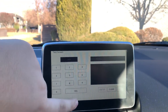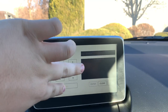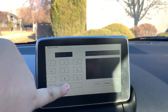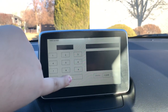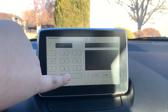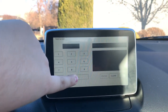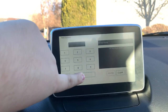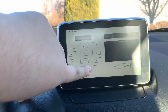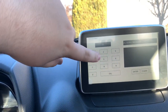So what you're going to do is hold delete until in the data window right there you'll get 'test active.' It should take about 5 to 10 seconds for it to pop up. There it is — JCI test mode available or active. So you're going to go over here and type code 11.